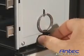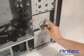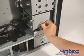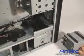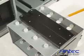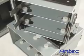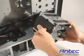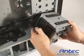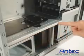First, you'll need to remove a single thumb screw on each hard drive cage. And then there's a little ring here, and this is actually snapped to the hard drive cage. Just unsnap that and pull the hard drive cages out. The bottom hard drive cage has silicone grommets, and the top hard drive cage also has silicone grommets, which have excellent anti-vibration properties. Also note that the top hard drive cage has a small compartment for storing things like screws or cable ties. Along this edge is padding.